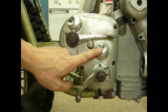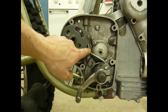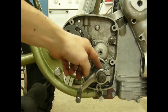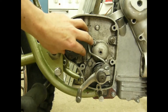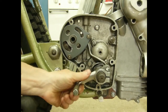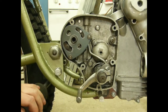Now let's take the cover off and see what is special about this gearbox. Quite a bit different from what you might be used to seeing here. There's a linkage instead of the lever that goes from the foot change spindle to the ratchet mechanism, and this whole part is different. The function is still the same, but the internals are different.